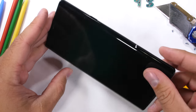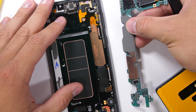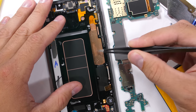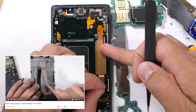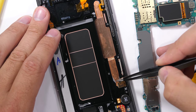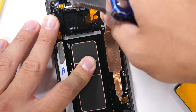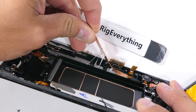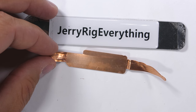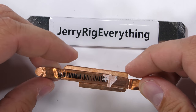Now for that water carbon heat dissipation system. It's definitely one of the larger heat pipes that we've seen inside a cell phone — way bigger than last year's Note 8, and looks to be about the same size as the massive heat pipe we found inside the gaming Razer phone. The only way we can truly understand this thing is with an autopsy, which means it needs to come out of the phone. Under the copper heat sink is the same adhesive Samsung slathered under the battery. Once it's out, we see that the cylindrical heat pipe itself has a large rectangular copper pad over the top. Copper itself is a fantastic thermally efficient conductor, so a solid copper plate is useful next to a super hot processor.